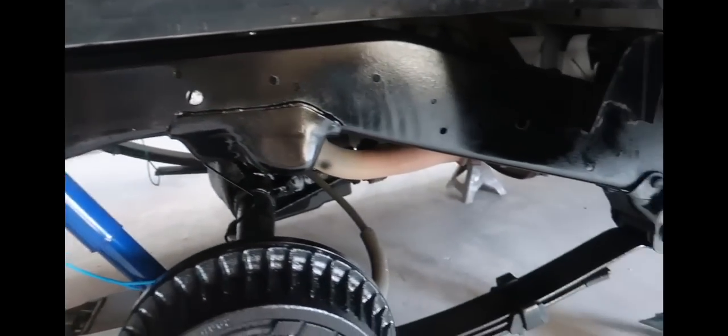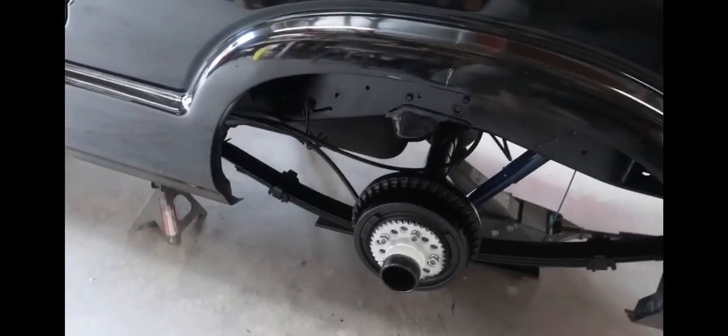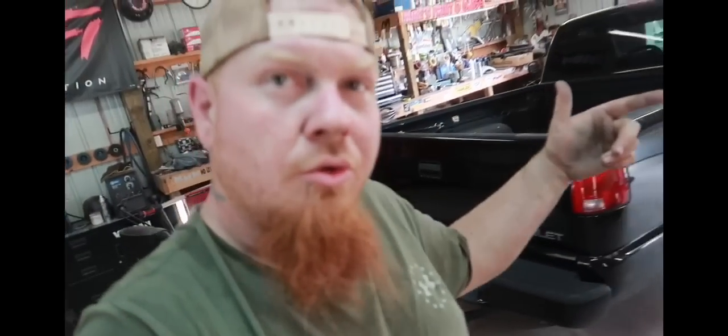The frame's all painted up, good to go. I went ahead and kind of dusted it all down - I don't want to get too heavy of a coat, don't want to overspray all over the truck and the new wheels. I need to get those little shock holders cut off, then we'll come back, get the nose around, get the wheel on. The three-inch drop blocks in the back didn't lower the front any. Had a pretty hard rake on it, hoping to level it out. I might add a one-inch drop spring on the front later - that ought to level it out pretty good.